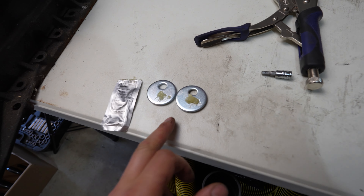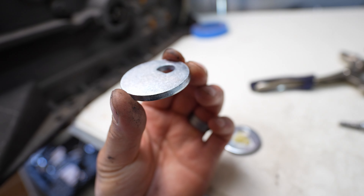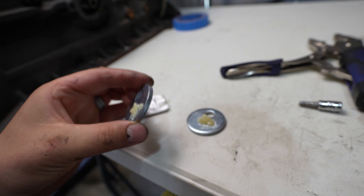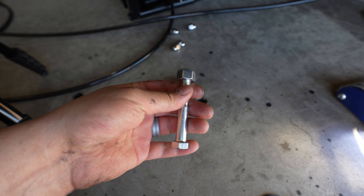Let's look at the adjustment washer — this side here is the bevel side, that's going to face the inside of the Super Pro, and the other side has a sharp edge. Spread the grease out. I try to put as much detail in the videos as I can so that all the troubleshooting I go through you guys don't have to — I can just take you right through the steps. You're going to use the supplied Super Pro bolt.